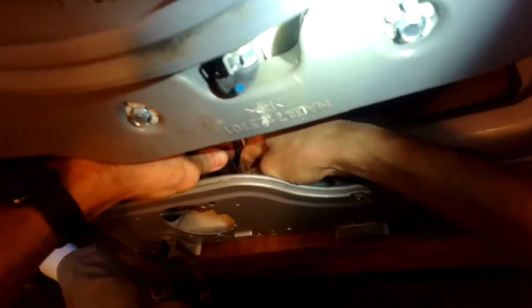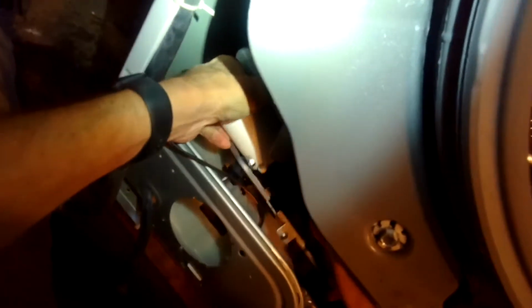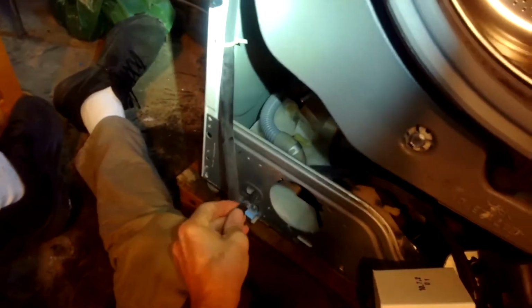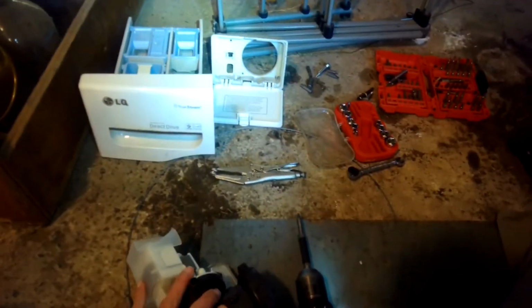I'm gonna pull this one out. Got it. Unhook this one. These are the leads bringing power to the pump. Get those out. Okay. Now the whole thing can come out. So you have a little more room off to your right, I think, to get it out. There we go. All right, and this is this little hose. You can bring that out. There we go. The third screw out. You can pull the pump off now.